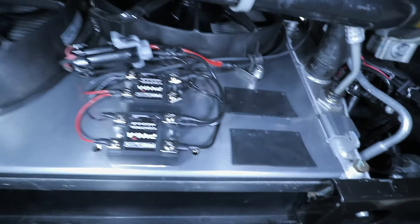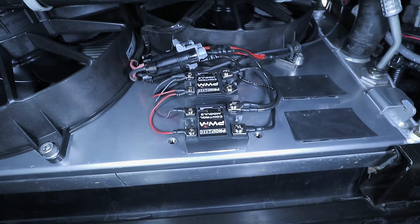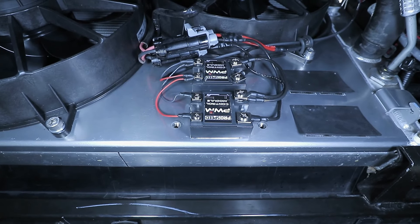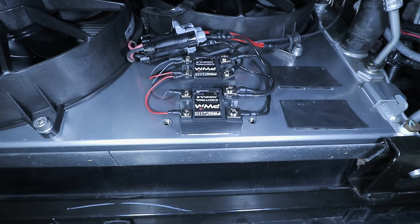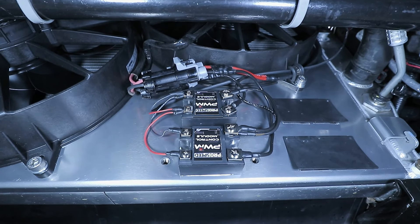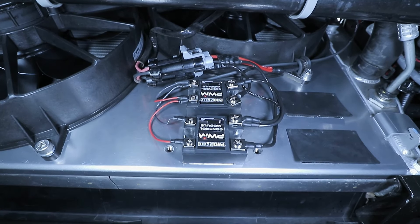What was hitting was the wires at the very bottom of the back cover of the fan touching the sway bar. Once I flipped it 180 degrees, I had about an eighth of an inch clearance with the sway bar bolted down. The reason my radiator support is dropped three-eighths of an inch is because I went from a 112mm to a 120mm throttle body. That's why it's dropped, which caused the fitment issue.